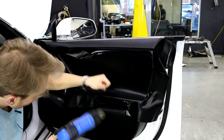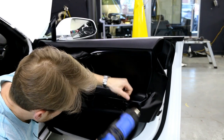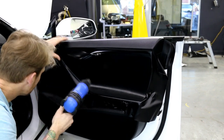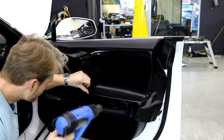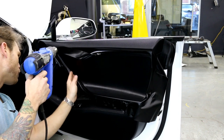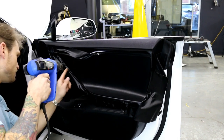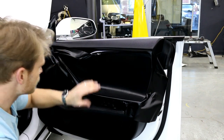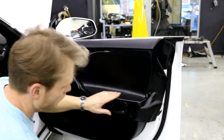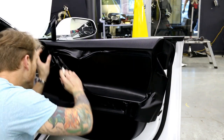I'm going to heat it up quite a bit, especially around those edges — super hot. We also have to be careful that we don't burn the interior. I think I'm pretty happy with this line. The top one's already done because we have a nice high energy surface with that plastic trim along the top to cut in between. It needs to cool slightly because you can't cut it when it's hot, and I need to find a good line.